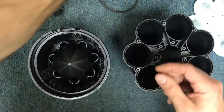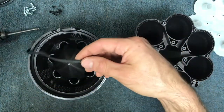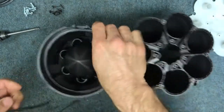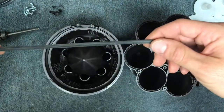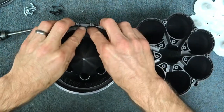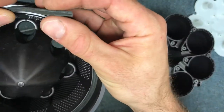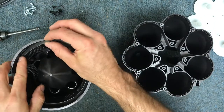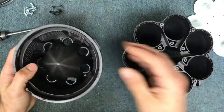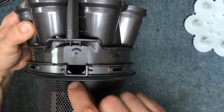Start by laying the circular gasket back down in there — it lays on itself. To put it back exactly as it was, look for a little flat spot on the gasket. It doesn't really matter much; just lay it down, and then one side has an indentation — that's the part that overlaps the other. As long as it overlaps at least some, that's what you're looking for.